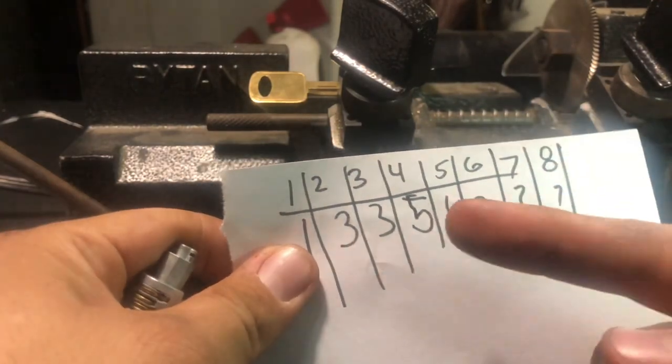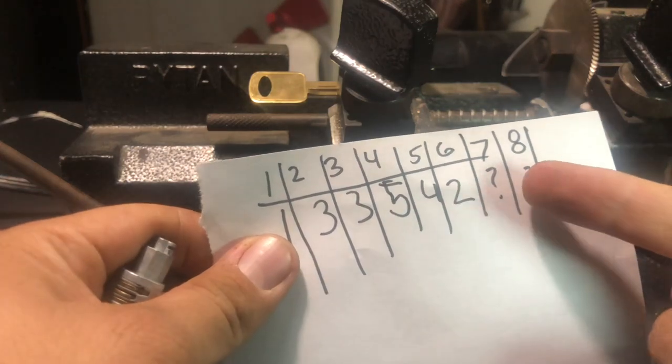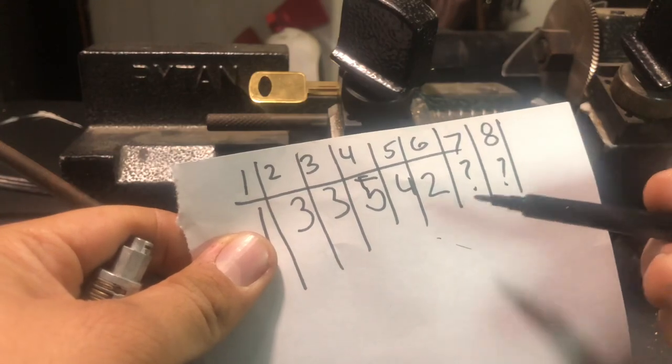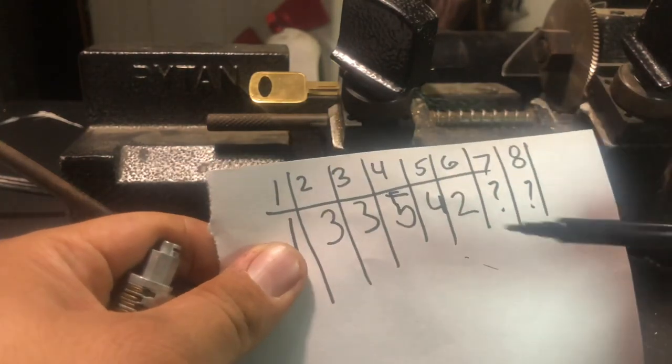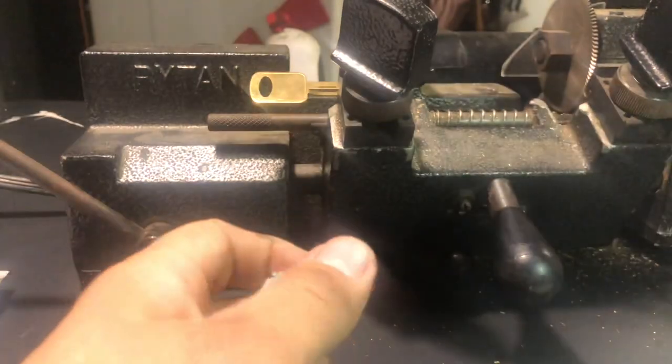Without these, you will not be able to turn. You'll turn the door locks, you'll turn the trunk, but you will not turn the ignition. You punch these into the software, and it'll convert these ones right here, and all you have to do is get the depth keys and finish up putting these on the new key, and you're done. You'll turn the ignition right over.